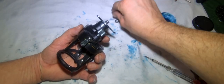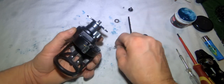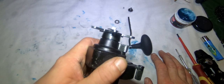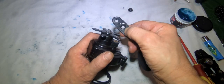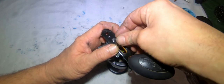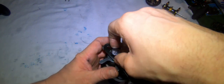The star drag is back on. Now we'll put the handle back on - this is why you kept everything together so you know what goes where. There's a spring plate that sits on there. There's a square plate that sits into the groove on the handle - you can position the handle wherever you want it. Clean off any grit or sand. Fit that on there and it's definitely worth putting a little bit of grease on the thread before tightening it in by hand.